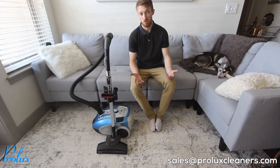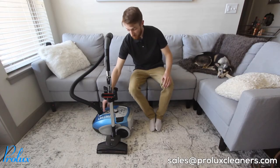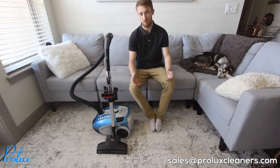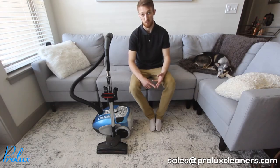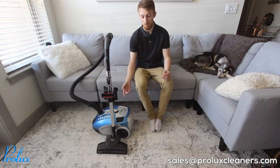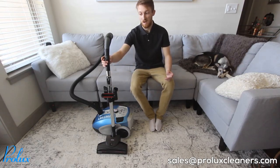The last thing I want to talk about is common troubleshooting. The insert has pictures showing what you can do at home. If you notice your vacuum suction is poor, test the suction directly from the hose inlet port — if that's strong, connect the hose and test from the hose, then from the wand. If suction is poor from either of those, you either have a clog, your bag is full, or your filters are dirty. If your bag is full, simply replace it. If your filters are dirty, you can use the maintenance tool to brush off loose debris, use a can of air or compressor to blow them out, or wash them — if you wash them, make sure they dry completely before reinstalling so water isn't sucked into the motor. If the turbo nozzle or combination floor tool suction is too strong on carpet or rugs, adjust the suction dial or open the relief valve on the hose or turbo nozzle.